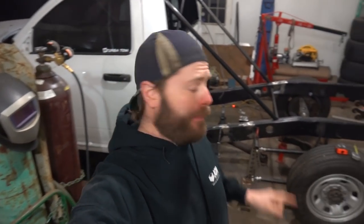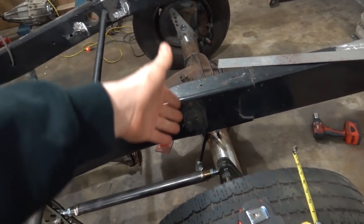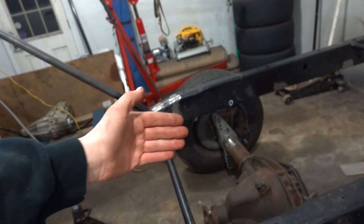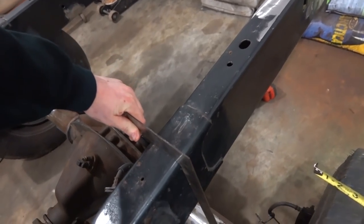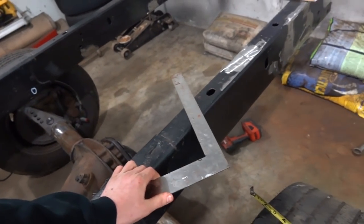It's the following night, picking back up with our four-link fabrication. I was looking online today and the guys at FirePunk have a video - a four-link kit with Vibrant clamps or something like that. Lynn over at FirePunk talks about the four-link setup and how he sets them up. What he says is: get the pinion where you want it, which we already have, then set your axle brackets to that making them perfectly plumb. The bottom of the bracket is actually flat, so we can get a zero angle on that and tack them in place. We're going to set it an inch and a half off the frame - I can just take my square, put it on there, and get it right.